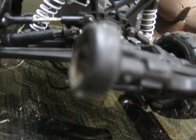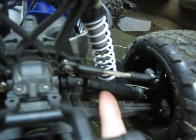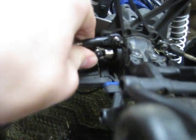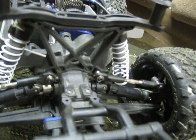I got the hardened steel version, but it was listed for the XL5 and Rustler. It fits into the differential fine and bolts in fine, but the pin here wobbles — it's not tight. Compare that to the other side which is much tighter. Less surface area contact might act like a knife and wear down the part faster.